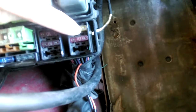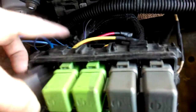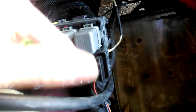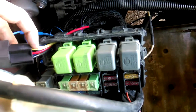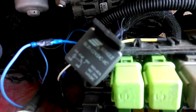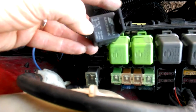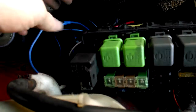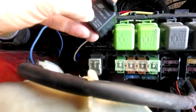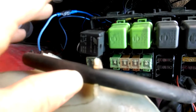The power comes from the wire right underneath the fuse box and connects to that fuse, then the other wire connects to a yellow wire which goes to my relay. So as far as power is concerned: power comes directly from the battery, goes to the fuse, comes out of the fuse, goes through this wire to that relay. The yellow wire is pin 30, and then the output power — the blue wire which goes to my fan — is pin 87.